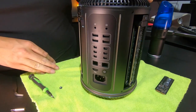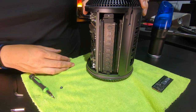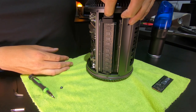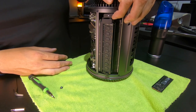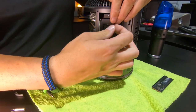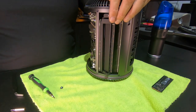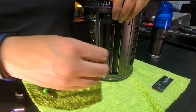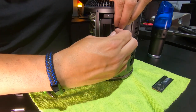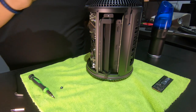We're going to pop both RAM sticks out. Right here is a little arrow, and you literally push that up in the direction it's pointing, then this comes out and you just pull these out — gently wiggle them out. I'm going to put these on top of the plate over here so there are no issues with static or otherwise.